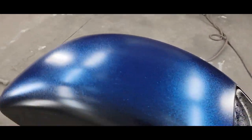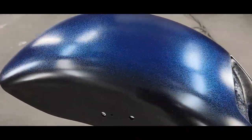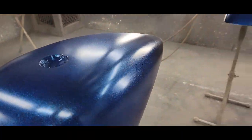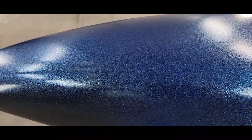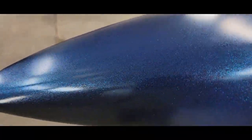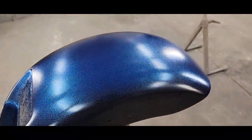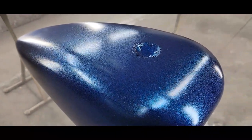Anyway, that's it for this segment. I'll clear coat and show you what it looks like after. This is my second or third metal flake job on video. Make sure you put enough clear on here so that when you sand it flat to get ready for the black, you don't sand through — sometimes these flakes are not colored all the way through, so you may end up with a hint of speckled silver. I'll show you a tip to fix those too. This video is a little different because we're doing these parts in stripes.